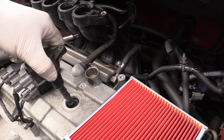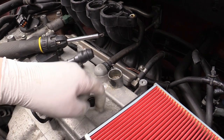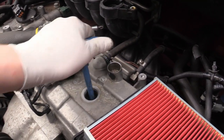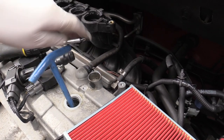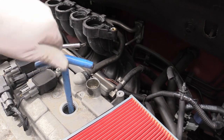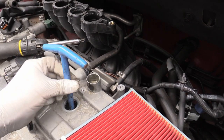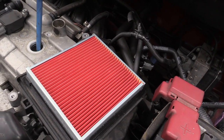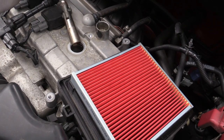This then just lifts out — it's quite long and a bit of a challenge with the lead length, but that's what fits on the top of the spark plug. The spark plug is now down in that hole, so you dangle the spark plug wrench in there — they're usually not too tight, just undo the spark plug. I tend to change these every year mainly because it's just so cheap to do, though you could probably get away with doing these a lot less — two or three years maybe. As you can see, the air filter looks almost brand new — it's almost a shame to change it.